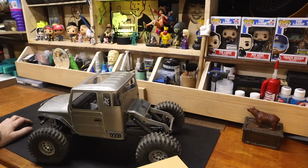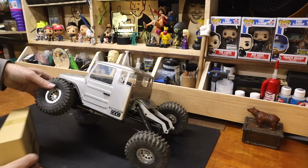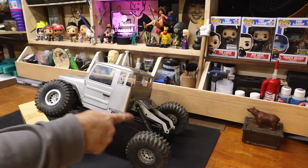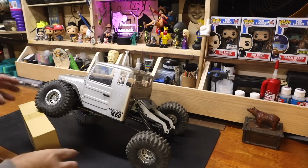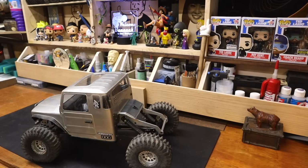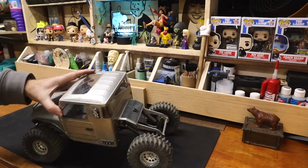Please don't put 110mm shocks on your 10-2. Just like, don't do it. It will give you the ability to do this, but it's going to ruin your handling at the same time. He can get away with these. He can get away with long arms because his chassis is a crazy thing that was built quite literally from the ground up to run 110s.